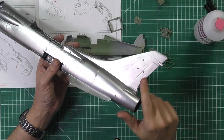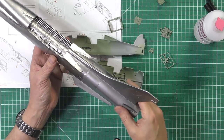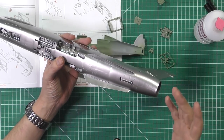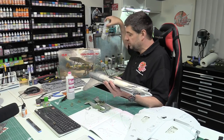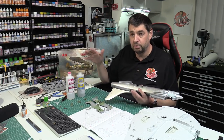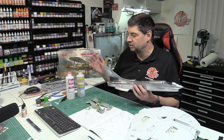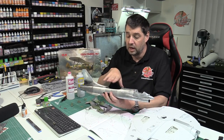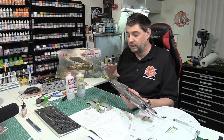I used these with the super metallics too and just went to town with it - it stuck and went down beautifully, no problem at all. I did it under here as well and threw it on, had no issues anywhere. That's great because if you'd used a slower setting thinner like self-leveling thinners, the chances are it would look quite gritty as it dries and settles down.